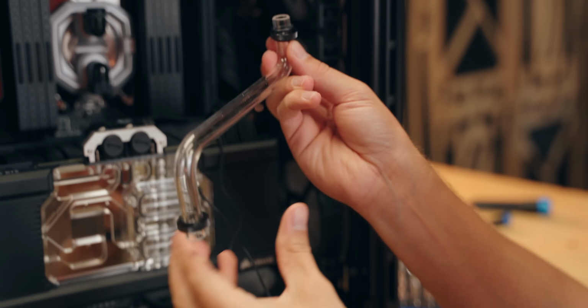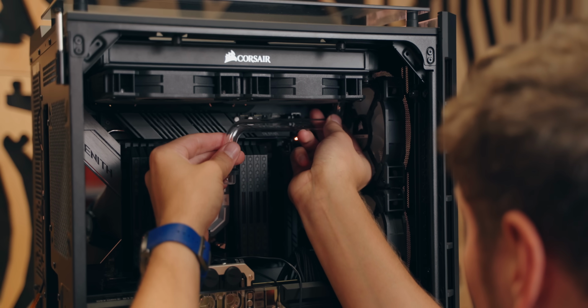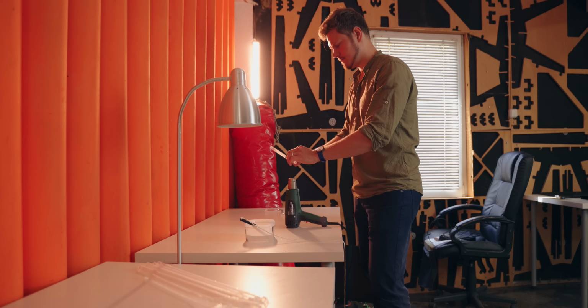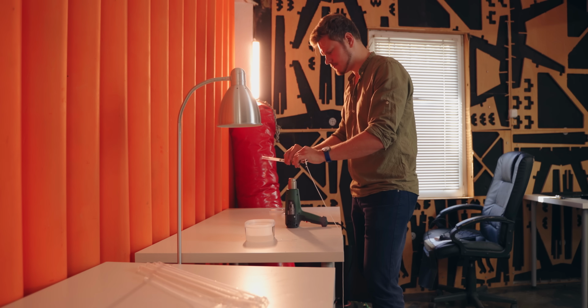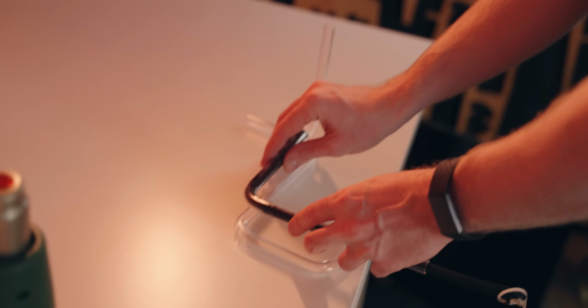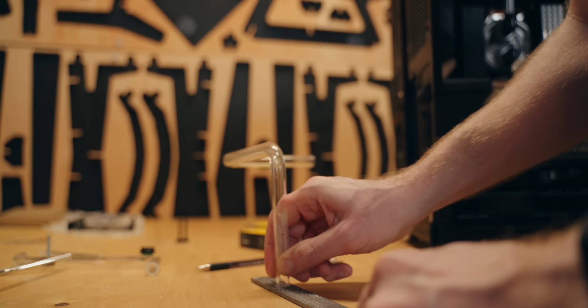And finally, it's all about installing each hardline tube one at a time. My top tube had perfect RAM clearance, and it was my first proper bend that came out very well. So with confidence, I moved on to the second tube. And here again, the 90-degree bend was just 2 millimeters off, meaning we could start from scratch or heat up that section again and try to reposition where the bend happens. And this is where HP stepped in, and we did it without destroying the tube.